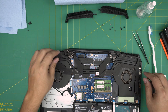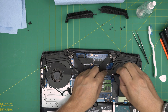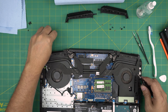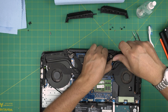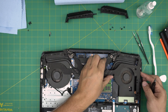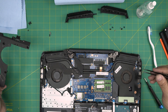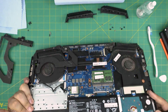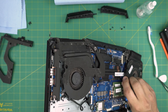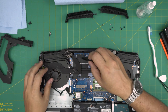Next, remove the supporting plate in here. Remove one screw in the middle, one screw there, and one screw on the twist side over here. This laptop hasn't been serviced in a long time so the screw base is broken and just wiggles around and falls off. The other base is broken too — this is exactly why you need to do your servicing regularly, so the heat doesn't crack all the plastic down here.